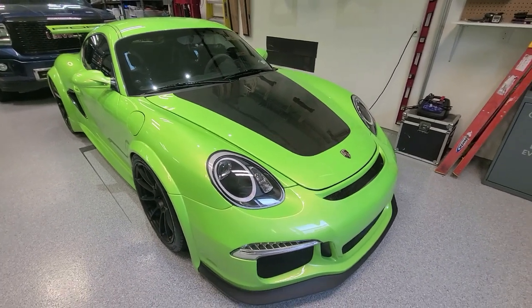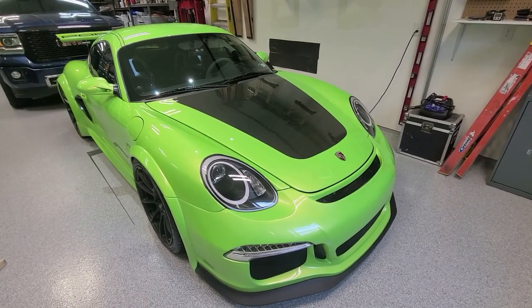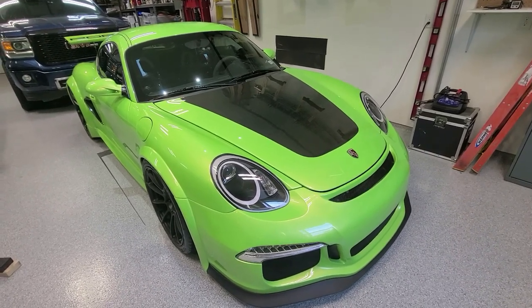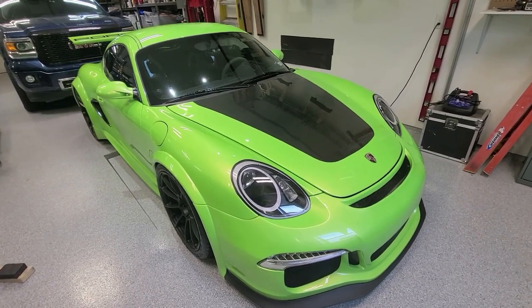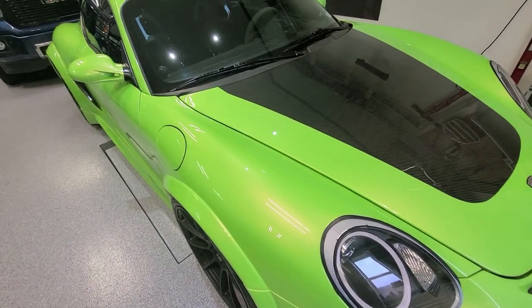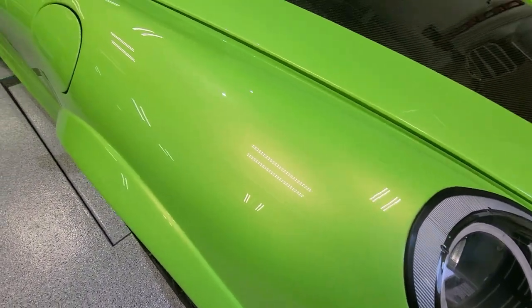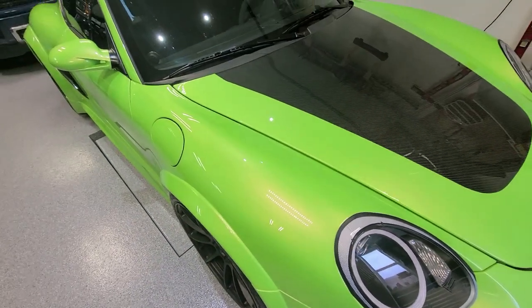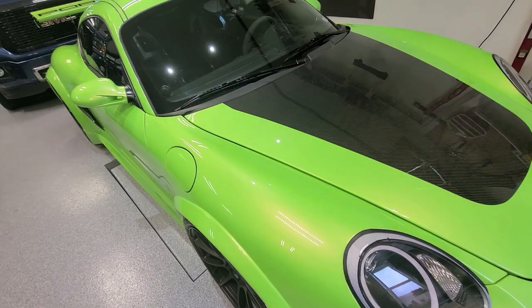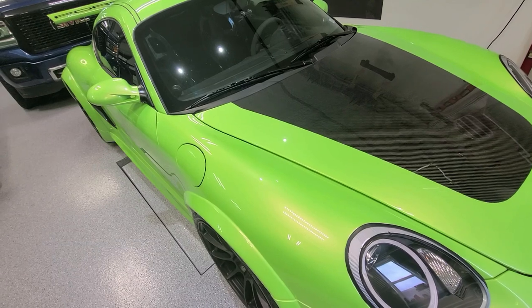This is Verde Ithaca — it's a Lamborghini color. It's actually a tri-coat or three-stage paint job. This is the one part of the car I really can't claim we did entirely in this garage, except for the final coat. A friend of mine, Larry Spencer, really made the magic happen with this color. Basically the car is sealed with a white primer, then painted yellow. The third stage is a green pearl tint — so you lay down a really bright yellow that looks like a banana, then you put a translucent green pearl tint over it, then clear coat on top.